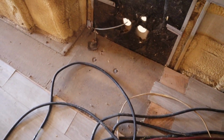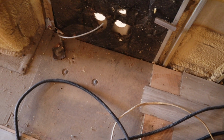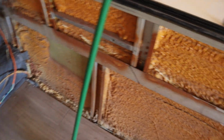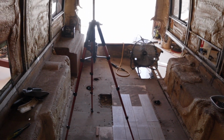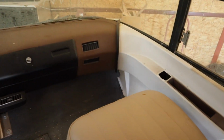Again, the main objective, that is one of 4 mounts. Those are just carriage head or pan head bolts sticking out the top. There's going to be, again, more there, about in that area, and over here. And those will be the side mounts. And because the back has already been taken out, those back body mounts are gone. The only thing other than wiring and linkages and tubes is going to be the 2 mounts up front here.